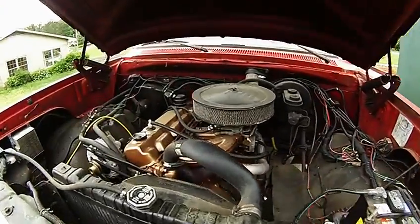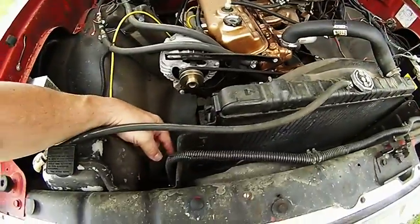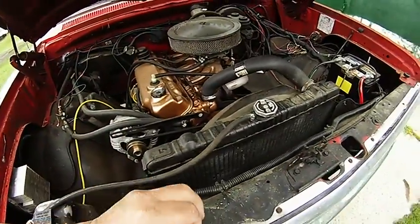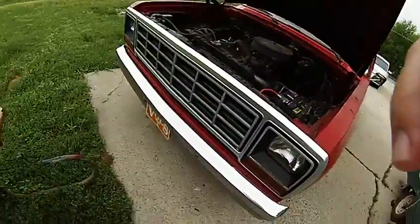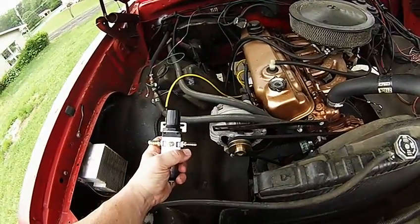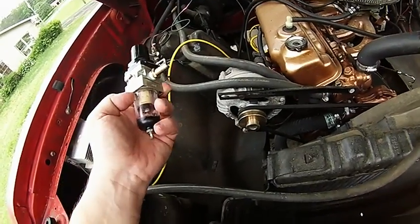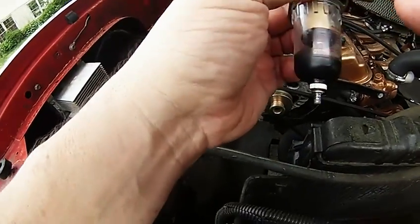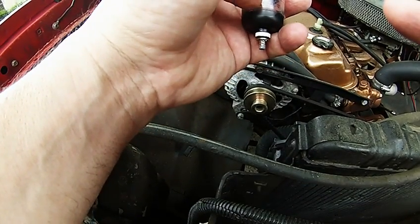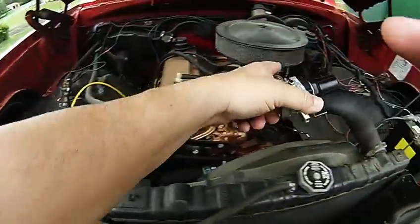What I want to do is take this hose here, come out of the PCV, and put it through a filter system located somewhere around in here, and then back into the engine. The reason is this one has a significant amount of blow-by — not enough for it to be rebuilt yet, but it's getting there. So I want to filter it through this mechanism. Have it leave the PCV, in through this port. There are vanes inside to induce a swirl. The oil vapor trapped in the combustion gases will spin, hopefully the oil will collect in the bottom, the vapor will go through this brass filter, and on into the manifold.